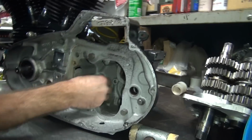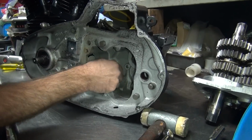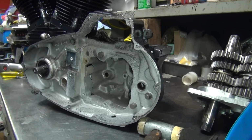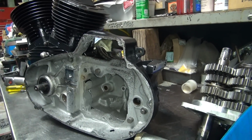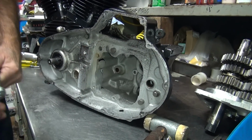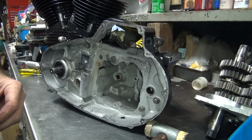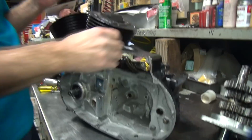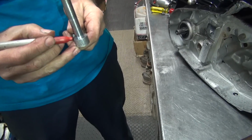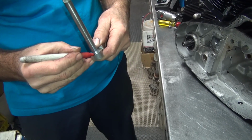I'm making a grinding noise in here. You can hear it. And it's not going all the way in. So this is too fat. This is way too big through here. Mm-hmm. See how it's making a mark in there? Yeah. That big line. So I need to go with the grinder and grind this thing to get this down smaller in diameter, because it's too big. These things don't fit most of the time, these aftermarket ones. They're just too stinking thick. So I need to grind this diameter down.